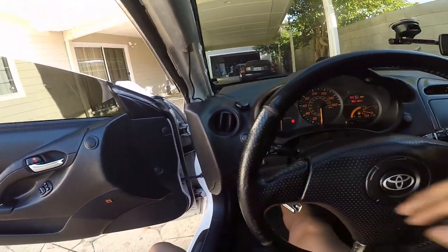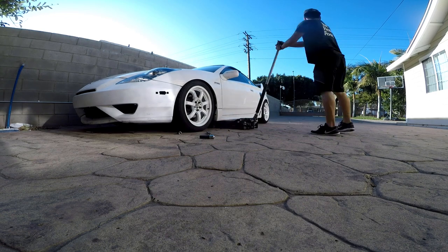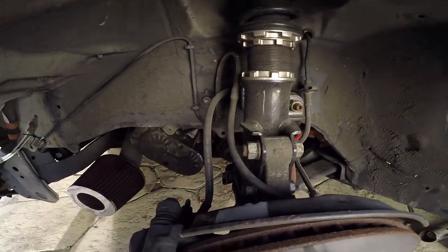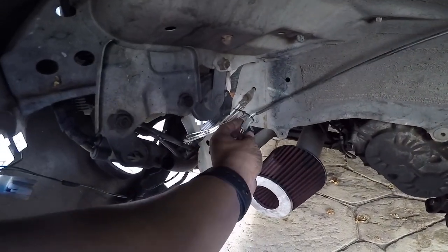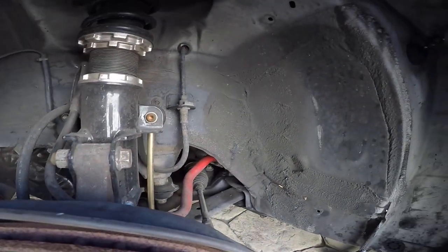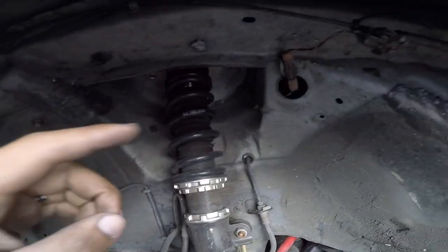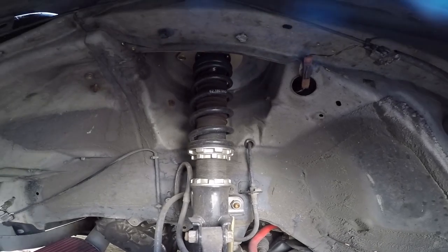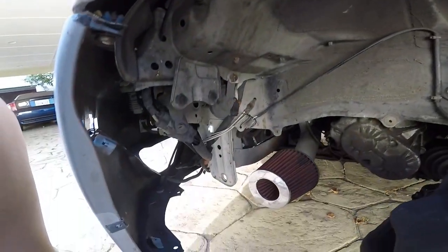So yeah, that's what I'm gonna do right now — take off the wheel. It's only this side that got messed up; I was taking a hard turn. This is your ABS sensor — some cars have it, some don't — and this is where it broke off. I just zip tied it when it happened because I didn't want to mess it up any more. Being low or with bigger rims, this hits the sensor and just broke it off.